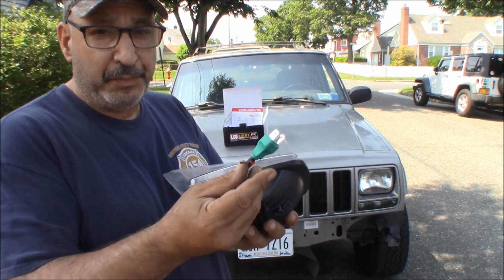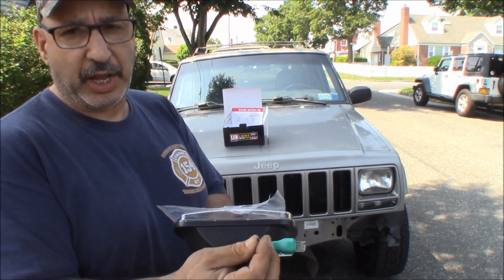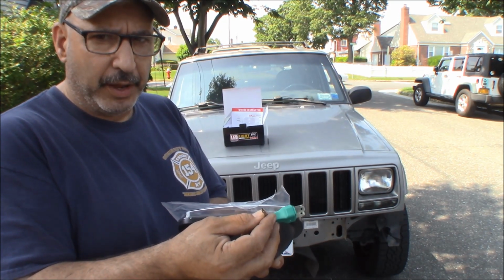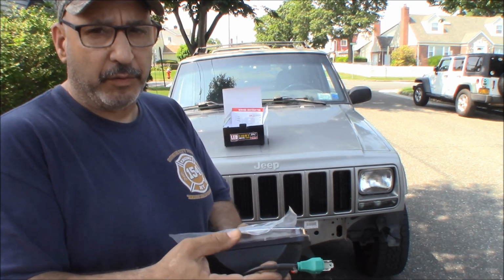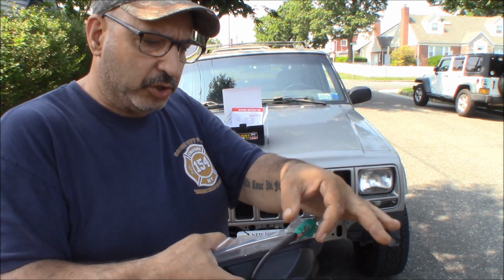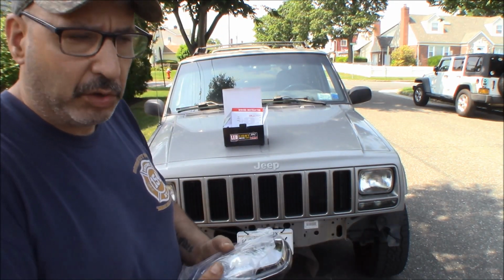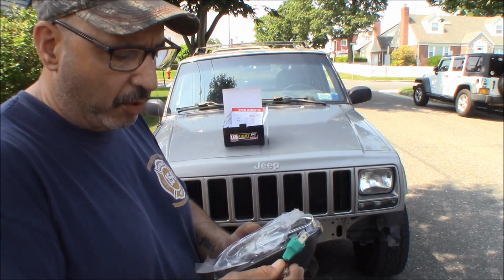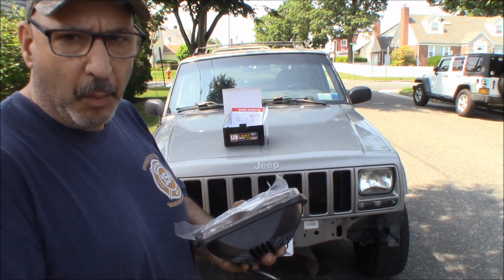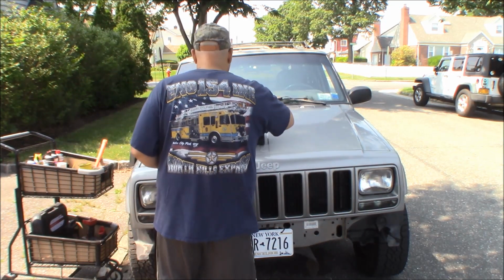It's a little tab coming off the harness. It did have one of those plastic sheaths that go over it, but I grabbed the plastic sheath to move it down to check to make sure this was crimped good, and the sheath disintegrated, fell apart, and fell off. And this was crimped fairly well, but I just put a little dot of solder in there just to hold it in place, just because I'm a little nutty, really. That's the only reason. It was probably crimped pretty good, but I did put some solder on it. And when we make our wire to go to it, it's going to be a soldered connection. I'm going to have the spade come in, and we're going to do our best to weatherproof it as much as we can.